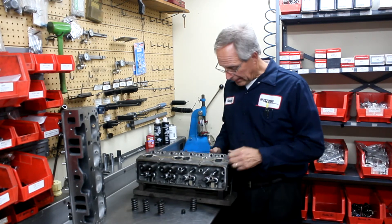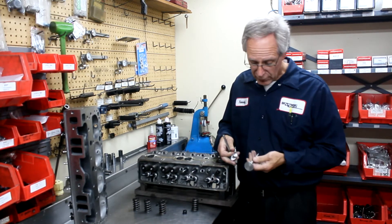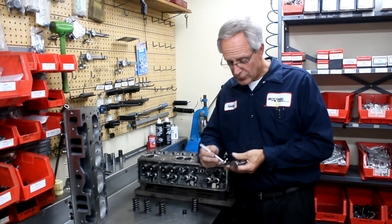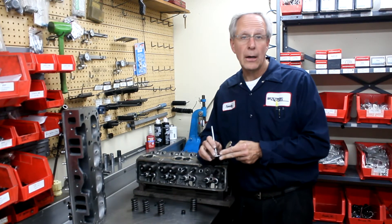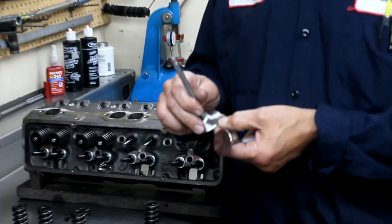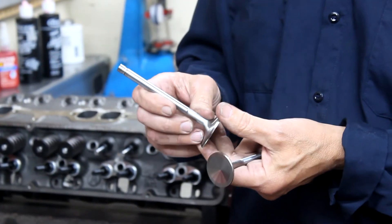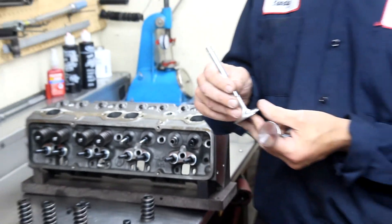Other than the valve train items, the valves in these heads really are okay. I don't know what manufacturer they are. The only issue we have with them is that there's no back cut on the valve — if the valve did have a little bit of a back cut, it would flow a little bit better. But again, there's no machining done to these heads whatsoever. The other thing is it is a neck down stem valve. We don't use neck down stem valves. Number one, the neck down stem doesn't necessarily flow any more air. Number two, neck down stems are illegal for some racetracks. So this could get you in a little bit of trouble.